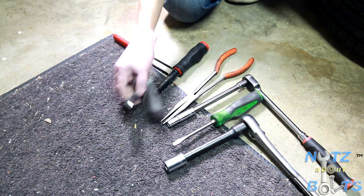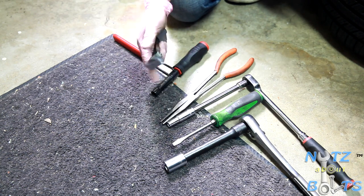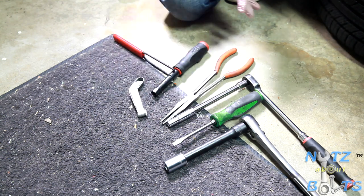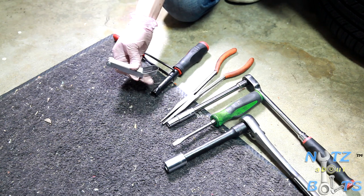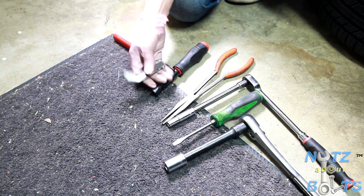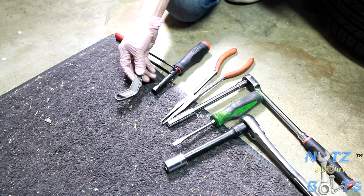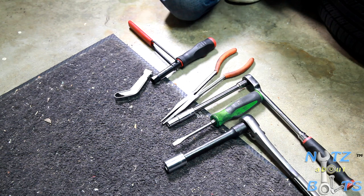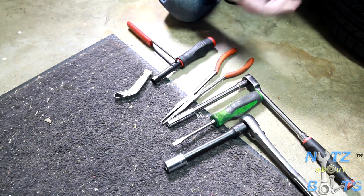And then the feeler gauge, of course, has these little thickness blades at about a 45 degree angle. Yeah, this one is good for this vehicle because the 45 degree angle helps with the kind of awkward positioning of the rocker arms, so that would be helpful. Or if you get just regular feeler gauges, you can always bend them because they're just thin metal.